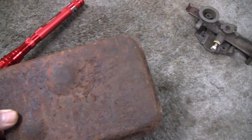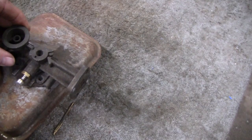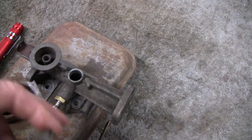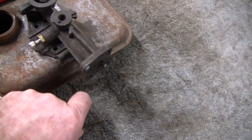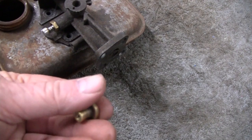I'm going to try to save this tank, but not right now. Also with the carburetor — it looked like somebody had rebuilt the carburetor here, but this throttle part is actually missing parts. I cleaned out the inside, but the throttle is missing parts, plus the suction tube had a crack in it. I tried to take it out to replace it and it broke off inside. But the screen is still good, so I can save that and use it for something else.